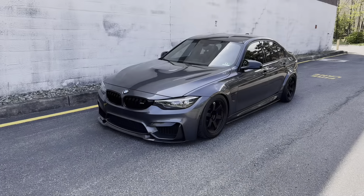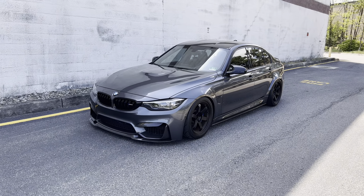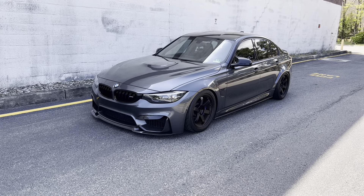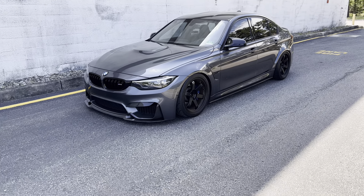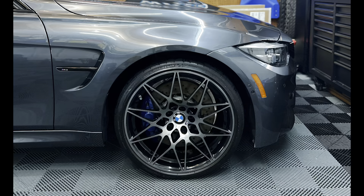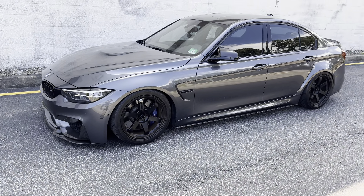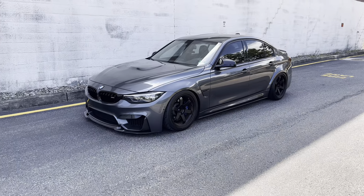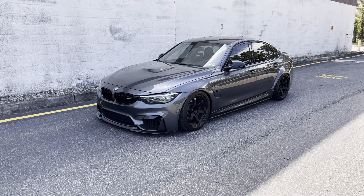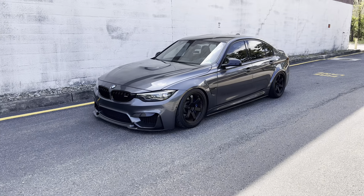The first modification I want to discuss is suspension. The stock suspension on these cars is great, but the overall ride height is just way too high. I'm going to throw up a picture of how my car looked completely stock — the front end is massively high. I understand a lot of engineering goes into these suspensions and they ride well and have the EDC, which is nice, but these cars lowered even just a little bit make a huge difference.